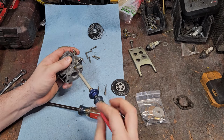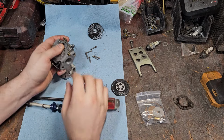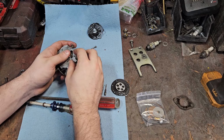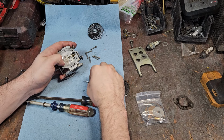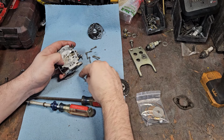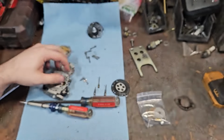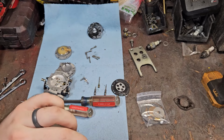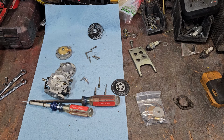And that's supposed to technically have sealant on it. Just from the factory it did. That's a spot for fuel to leak right there. Hold your needle in. Later on they went with just a screw on the inside. They were smart. We're just gonna leave you there. And then to get that out, there's a special socket that I've had to grind down. You know, God forbid, something be simple.